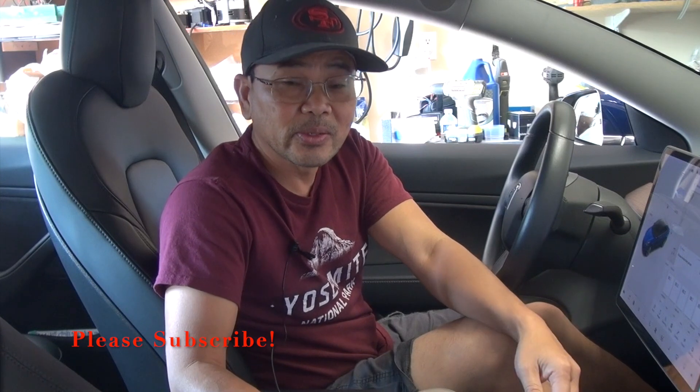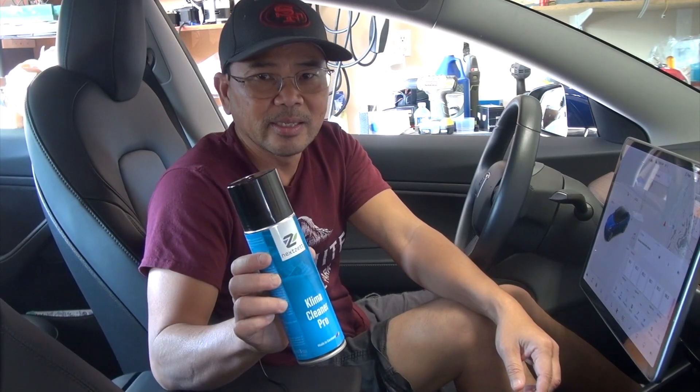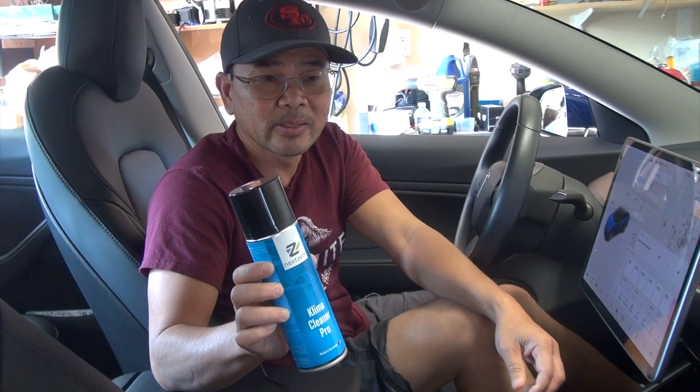So with that, thank you for watching the video. As the lessons learned: you just can't get rid of the smell by just replacing the cabin air filters itself. You also have to attack the smell using the AC evaporator cleaner, as well as spraying Lysol into the AC system as well. I hope this video is helpful to you. I do have other DIY projects on my channel, so please check them out. Thank you for watching and I hope to see you again soon.